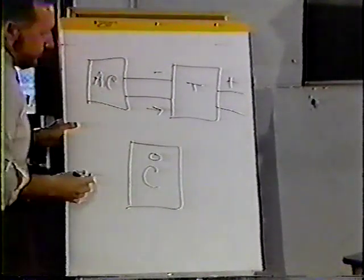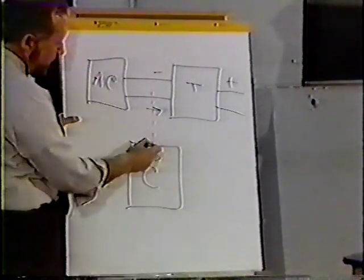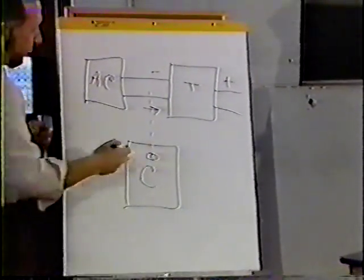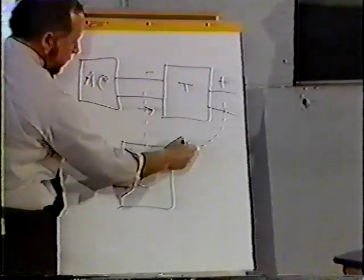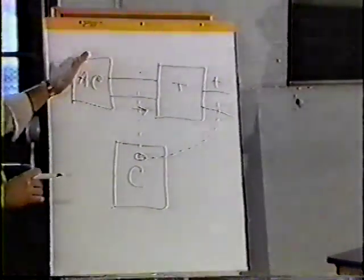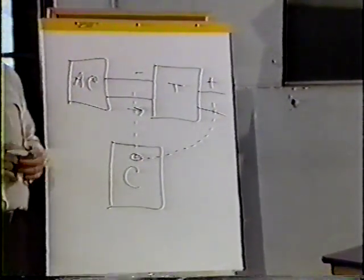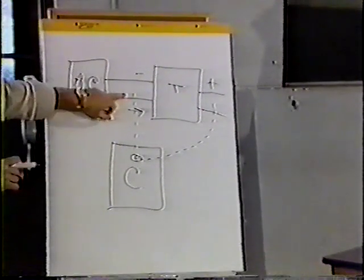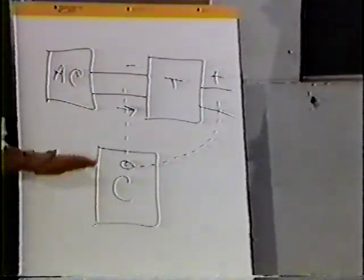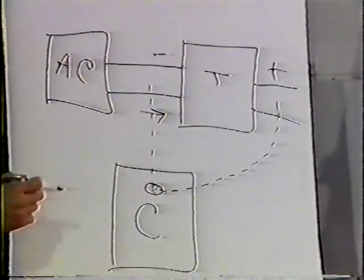the positive side. If you have a compressor with an inlet line that is hooked into here, that would be considered an air cleaner style compressor. If it is hooked in this side of the turbo, the positive side, that's a turbocharged compressor. When you change your engine air cleaner, if you have the engine air cleaner style, you've changed the filter on the compressor. You have to make sure that this line doesn't break or come loose or cracked in any ways, because then you will bypass the filter and draw dirty air into the compressor.